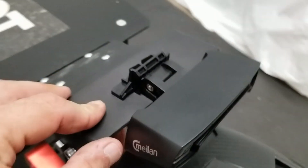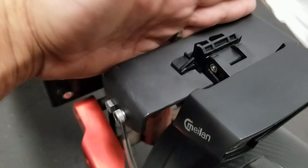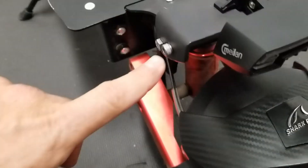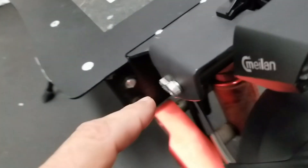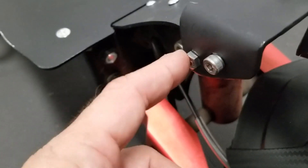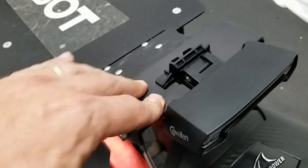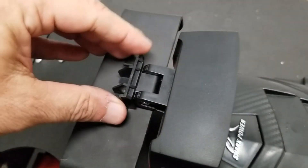I painted it and shaped it — nothing fancy. My RS7 already had a footrest, and when I put my foot up here part of my foot kind of rests up against that, so it kind of works out. There's this little bar here for structural strength that already came with it. On this piece I just drilled a hole, used the same screw, and got stainless steel hardware from one of the box stores with some locking nuts on the back side. That way this piece doesn't move back and forth — it's locked into place. You can stand on this thing, it's super solid.